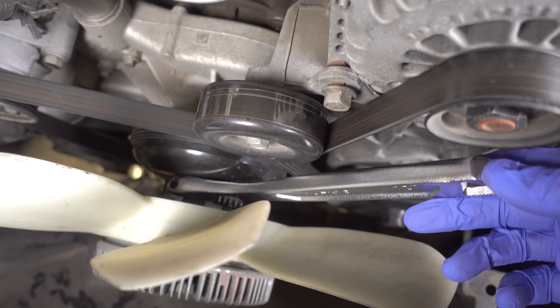I've got this bracket pretty loose. I've actually had to remove all four bolts here for this bracket completely. Now I can slide this bracket up and out of the way so I can get at this power steering pump. I was actually able to wrestle this thing out and I'm now hoping that I can remove these two lines and strategically place that dripping fluid into my drain bucket below without getting it all over everything.